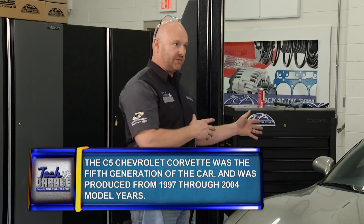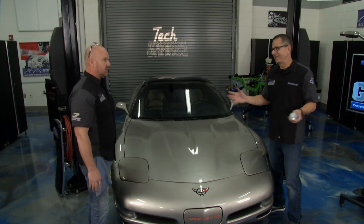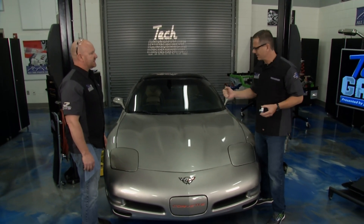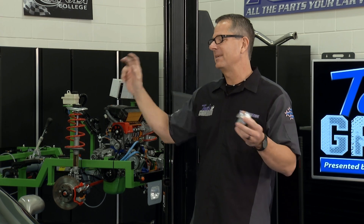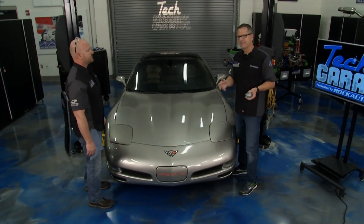I have an idea of a starting point on the C5 — it's one of my favorites, there are some common failures. Talk through your symptoms again: no grinding, no lock up prior to that, no anything. I went to shift it and a couple of symptoms — it was actually falling back and forth really easily when I went underneath to shift it, very easy to shift as well. It's probably a cable issue, but a visual inspection is always in order.